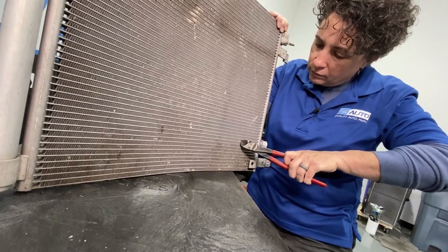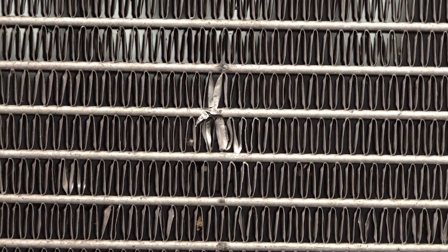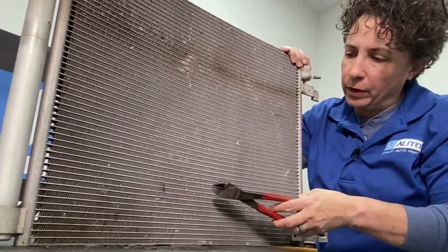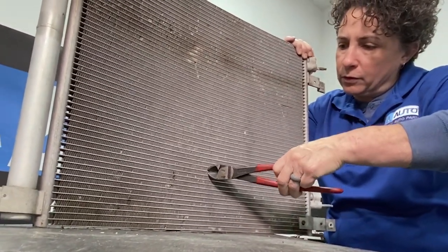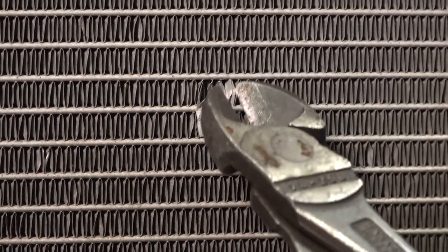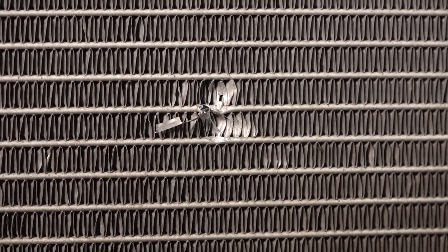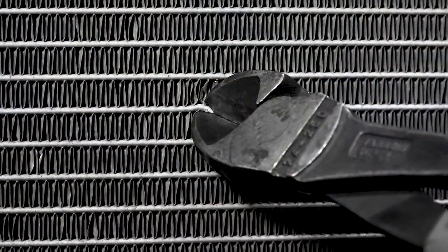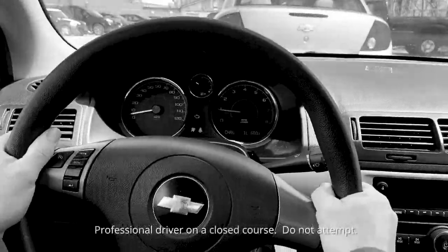I want to show you just how easy it is to break these tubes. These are fine little tubes that go from side to side — it's a crossover so that the Freon can travel through. Now imagine you're getting a little fender bender enough to push this, but the piece of metal inside your car is rubbing up against this as you go down the road. Look how easy that is — I just cut that and peeled that. If you had friction in there with a piece of metal from that front bumper hitting that over time, your AC might be working right after that little bump, but about six months later, or even two months later — no Freon. And you will never think that it had to do with that little fender bender.